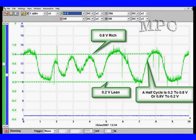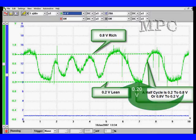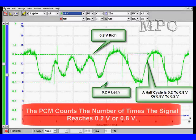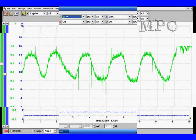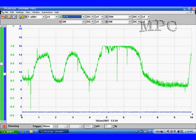Here are the voltages that Chrysler uses. The first is 0.8 volts at the top — we've put a line there — and at the bottom we've added one for 0.2 volts. Chrysler does a measurement where they count the number of times the signal reaches 0.8 and 0.2 volts, and they call that the half cycle counts. This is a big improvement over things like the old cross counts we used to see in scan data.